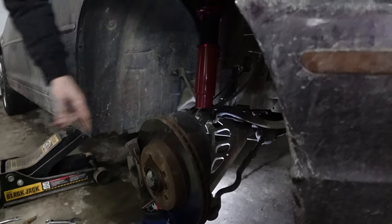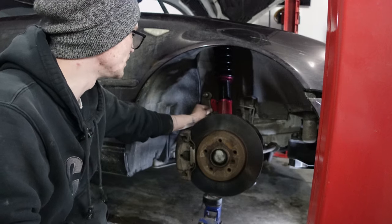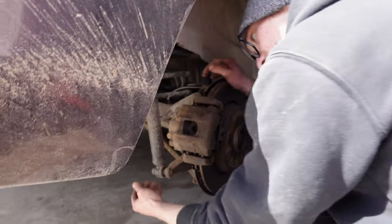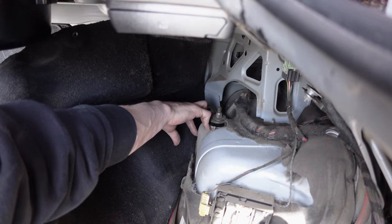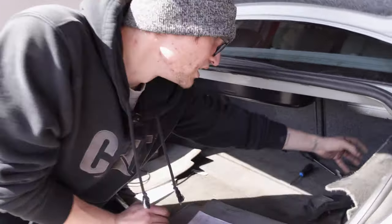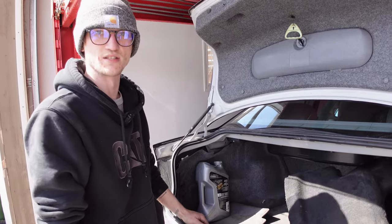Now I'm going to jack this up, get it where I need it, put the strut into the pinch at the bottom, make sure everything's tight and anti-seized, put the sway bar end link in, and blast the bolts in. For the rear, you've got one bolt that locates the back of the strut and then two bolts in the trunk area. A lot of people have to remove carpet to access them — I love on the E92 how there's actually a hole drilled for access. I'm going to drill a big hole when I put this back so it's easy to access in the future, especially since these are damper-adjustable.